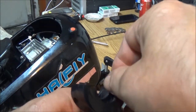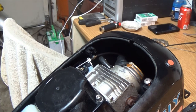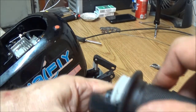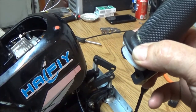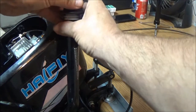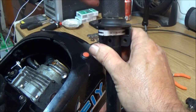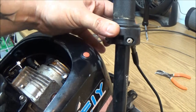I've got my cable run down through there, and it is out — see it there. Now let's hook this up to the throttle. It goes through there like that, and you flip this around. There's a hole right there on both sides, so you've got to make sure you line it up. Now you've got to get this one on there, just like that. Now let's tighten our screws up.